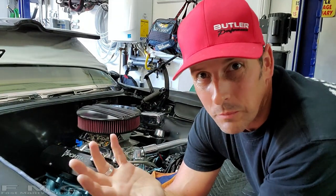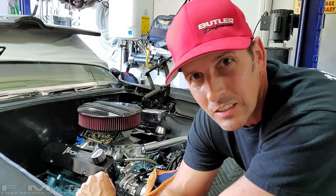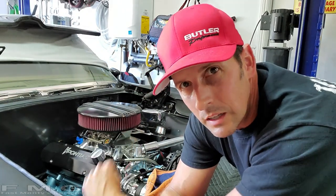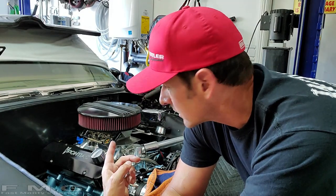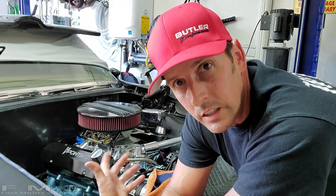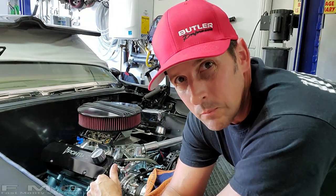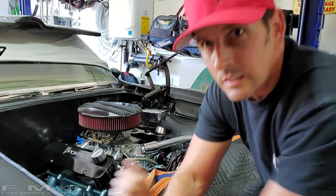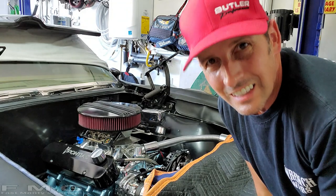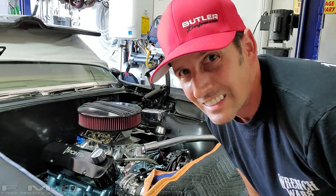That was easy. I'm not an expert at carburetors, but what I do know is the more airflow you get, typically the more power - as long as you have everything else in tune. Headers, heads, exhaust - get more air in there. I highly recommend you go get a dyno run or two to get your carb settings right. I had mine re-jetted and tuned on an engine dyno - it was 505 horsepower and 600 pound-feet of torque - so I can't wait to fire it up. Subscribe if you haven't already because next episode we're gonna get rid of this thing right here. You know the drill guys - build them fast, drive them faster. See ya!